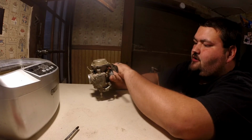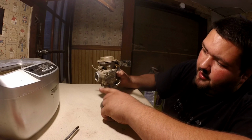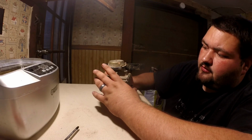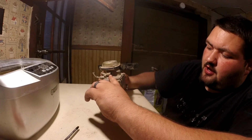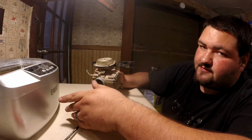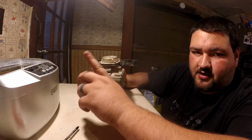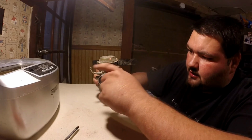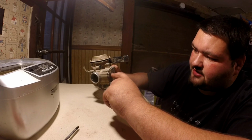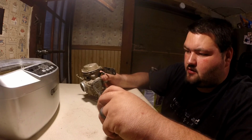It's got a bolt here, I think it's 11mm. And then you have one fuel line down here and one fuel line up here. You're going to disconnect those two. And then you have the choke line that goes right into here. It's a 12mm bolt. It takes a special wrench. There's another video on my channel that tells you how to make your own, so you don't have to buy one. And then you have your throttle cable, which is actually going to be in here, which I've already took mine off.